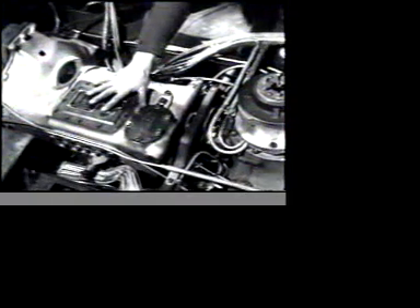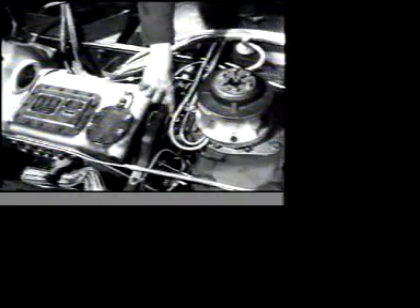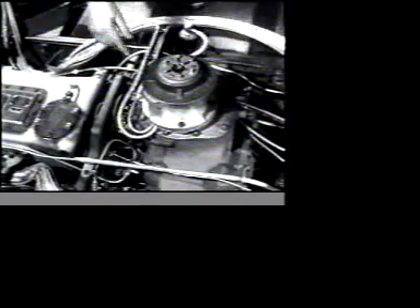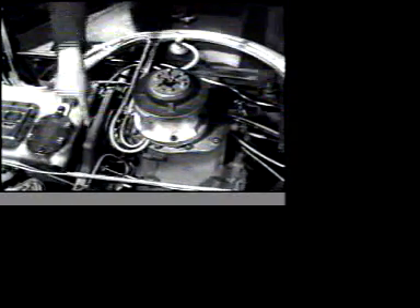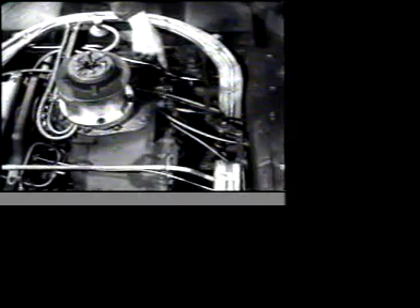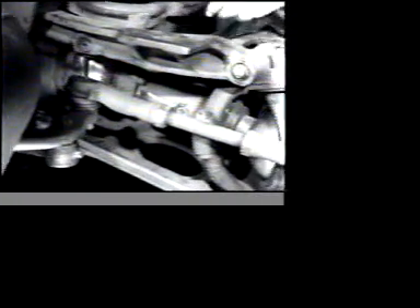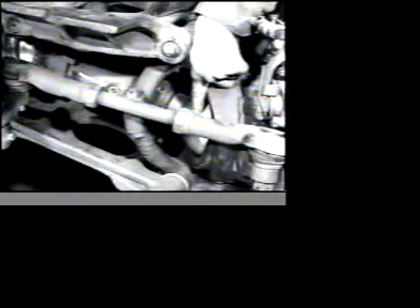From this simple principle has been developed the five-speed epicyclic gearbox. The next stage in the transmission is the transfer box, which contains both the differential and the reverse gears and sends the drive out to each of the four wheels. Watch closely and you can see the universal joints of the four shafts turning. Following one of these shafts, we come to a bevel box which turns the drive outwards to the hubs through more universal joints known as tractor joints, which allow the drive to flex to the movement of the suspension.